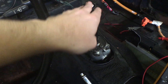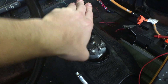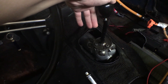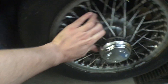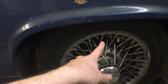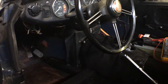Initially I thought this might have been one of my earlier settings in the motor controller where I limited RPM and also limited torque down to something very docile, so that when testing I wasn't going to break something or have things spinning wildly out of control. I thought maybe it couldn't overcome some of the old rust that's probably in there. But if I can spin it easily with my hand, the resistance to the shaft isn't that great. I went in and bumped up the number of Newton-meters of torque allowed, and I got the same result — it still makes a funky sound when spinning.